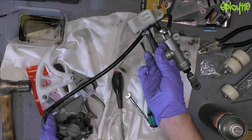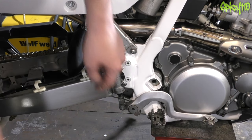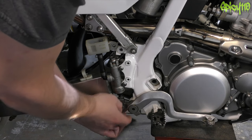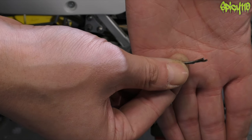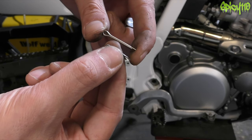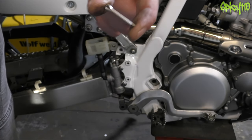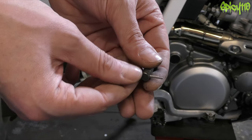So I'm just going to pop that back on the bike. We've bolted that back on. Now we've just got to get the pin back through — we need to press the brake a bit, makes that a million times easier. There is then a washer on the other side, and then there is a split pin. This split pin has seen better days, so I'm going to look in my kit and see if I've got some. So I've found a new split pin — this looks a lot bigger, but it isn't really because the eyelet is a lot bigger, so the length is the same. And as long as it goes through here, which it does, we can use that.